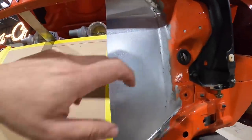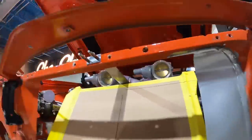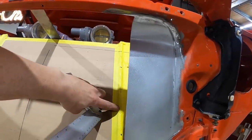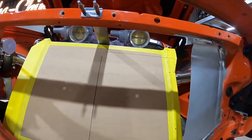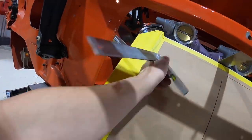One side of our closeout is all set — we just hammer-and-died this radius up here. I was only going to do the passenger side, but I'm liking where this is falling on the actual bead weld of the radiator core. This is creating a nice box for the core to funnel air through exactly where we want it. I'm going to do the same on the other side, coming out about three inches so we're nice and square with the actual weld.